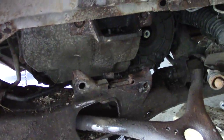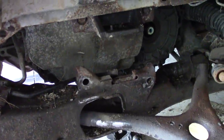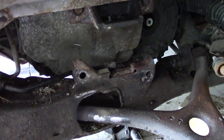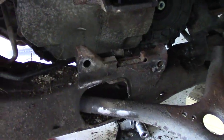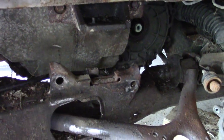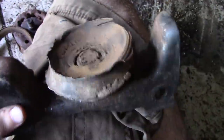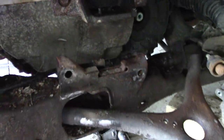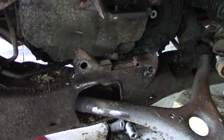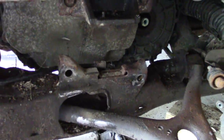We saved this car just barely in time. While I was pulling the strut out, that's when I saw the mark on the transmission. I put a pry bar right there, lifted up on the motor mount, the whole thing came up and moved around. I told myself we are not going to lose because of that reason this time. This may be a hurt car, but I want the chance to ruin it correctly — I want to bend the frame, cause as much damage as I can to my own vehicle — and we're not going to kill the transmission. So make sure this mount's not broken; put a brand new one in there, use that same solid rubber motor mount every time you run one of these cars.